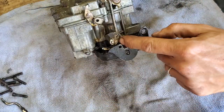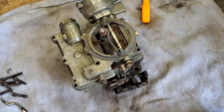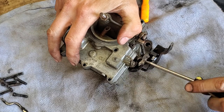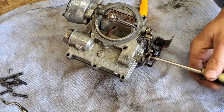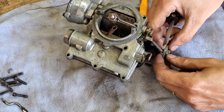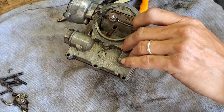So just go around the carburetor, take note of all the little linkages, take some pictures. You'll see there's a big flat over here, and that just unscrews, allowing this to come free so you can separate the air horn. That can be a little tight. It's very important that when you go back to tighten these, nothing gets bound — it's got to be completely loose when the screw is tightened. There's a tooth on here that allows this to slide out.